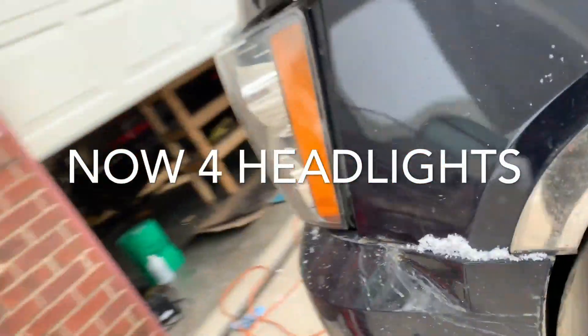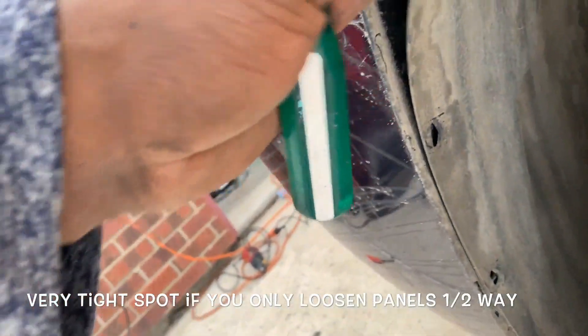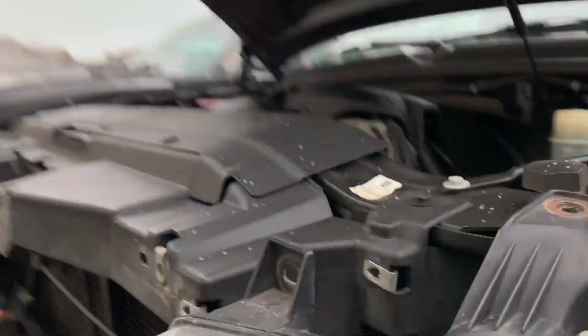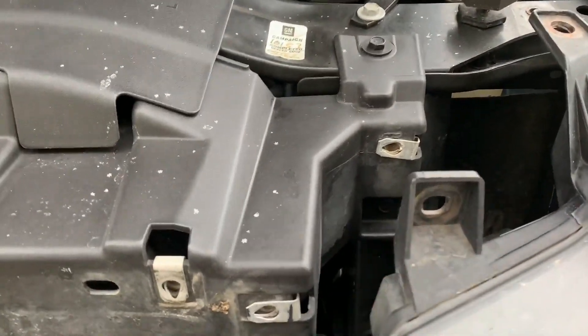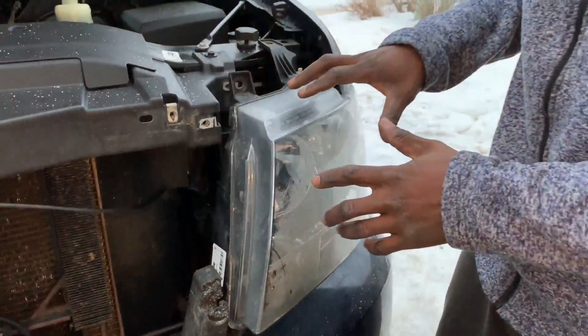Letting this dry and then putting it on so I can drive the thing. Next, replacing these lights with new projector lights. First, take off these panels with the panel clip pliers. Then you get in here — if you can see, there is a 10 mil bolt right there. Gotta loosen that on both sides. These lights come out; the new ones are smoked.